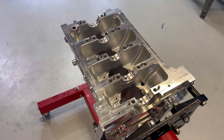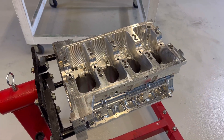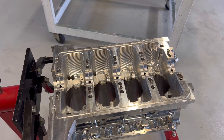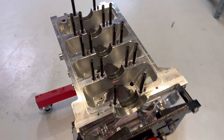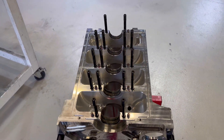We're all nice and shiny — it's just like doing the dishes at home, which I never do actually. But let's bang some bearings in it. We'll start with the standard bearings. We're aiming for about one and a half thou, just over. Ready to bang the bottom on and we'll measure up the clearances.